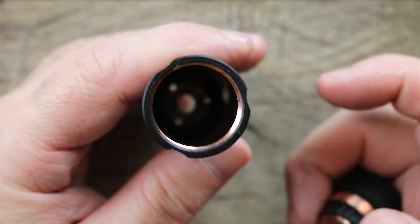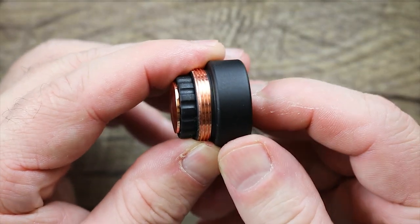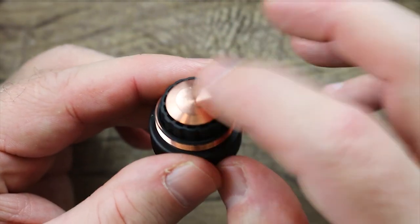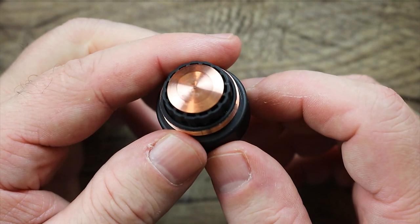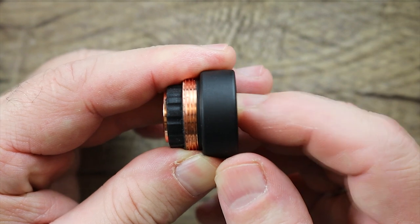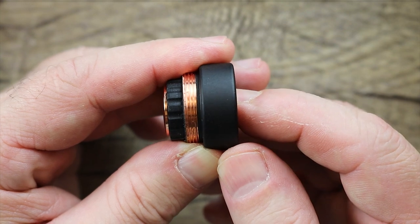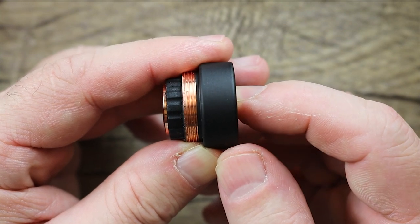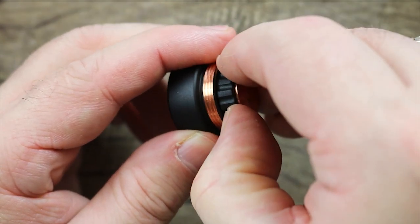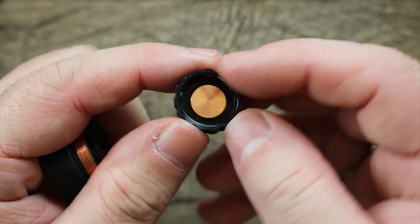I like those little safety precautions. The main star of the show is the magnetic switch. This is constant contact, meaning it's always in contact with the negative part of your battery. The contact is happening inside with magnets — but instead of magnets that oppose each other, they're using magnets that are basically trying to stick together. In order to take the switch apart, you pull out this little insulator piece, which also has venting in it.